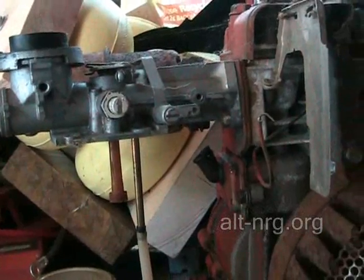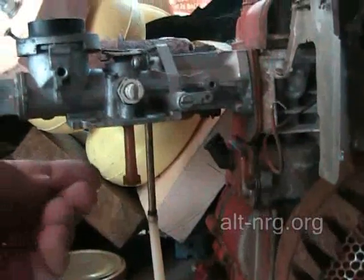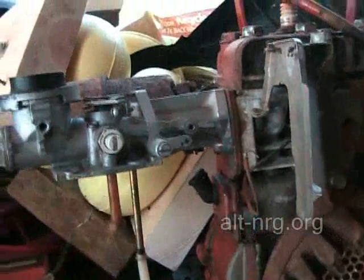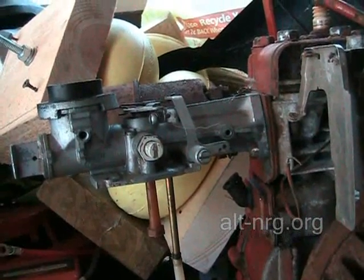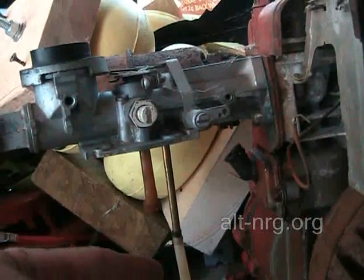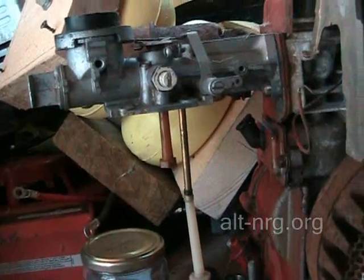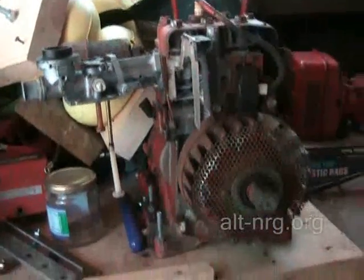It pumps down into a smaller reservoir for the actual gasoline pickup tube that is injected into the carburetor. This is the pumping tube — the long tube. It pulls the gasoline up and dumps it into the small reservoir underneath the carburetor that actually picks up the fuel to be burned. Retrofitting that to some sort of glass tube that I can use to actually visualize and see the amount of gas being consumed is the tricky part of this project.